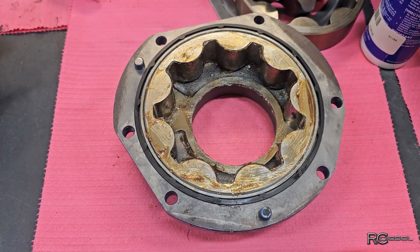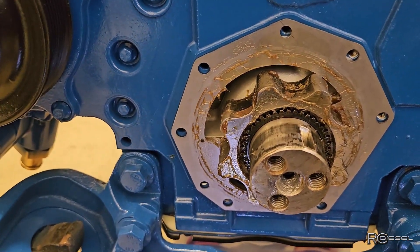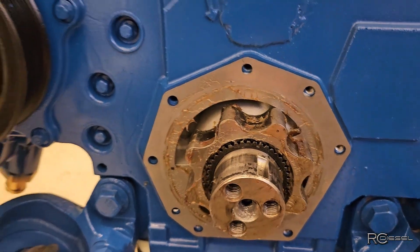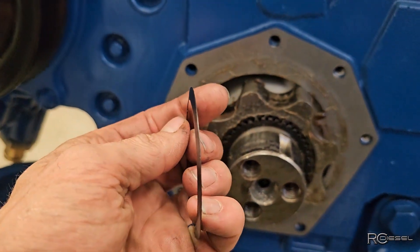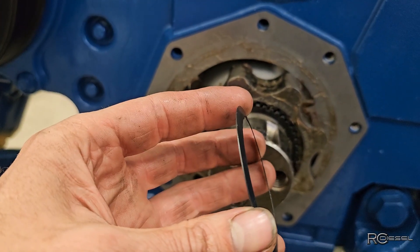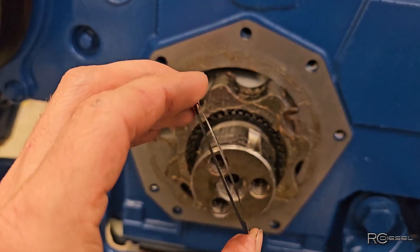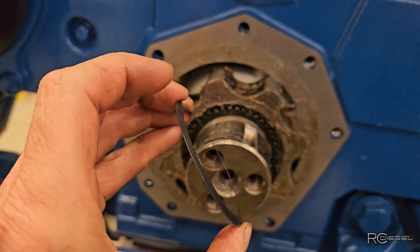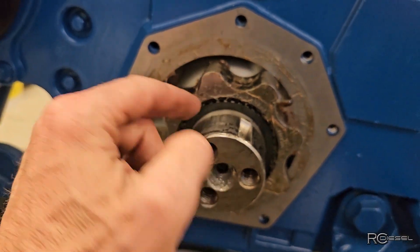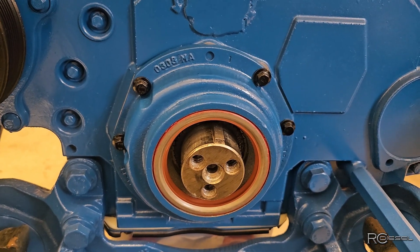A little smear on top - this top side goes against the wear plate we already greased, but we'll add a little more anyway. Pop the new seal in there and now we're ready to install the oil pump housing. I should mention this for people looking this up as a how-to: there's a spring washer that goes in there. You can see it's beveled - the inside is beveled in and the outside is beveled out. They want the outer bevel facing out, so the inside bevel goes inward and the outside part sticks out more. Hope that makes sense.